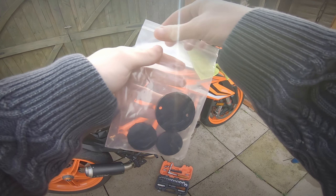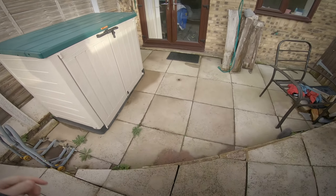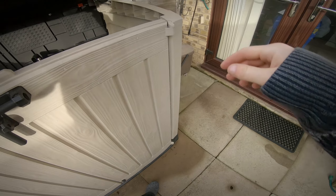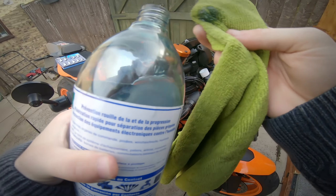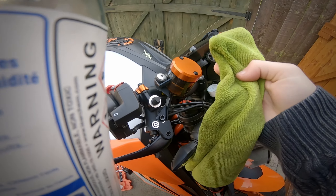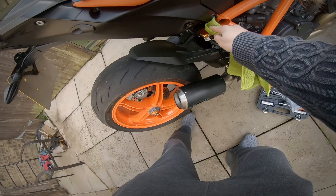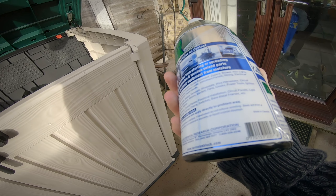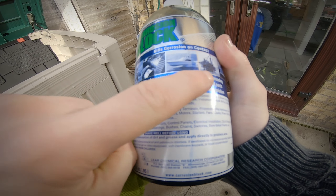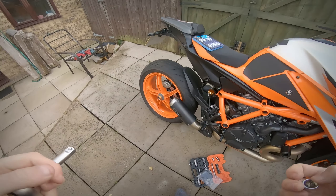Make sure they're cleaned out — I can feel the brake fluid on my fingers. I'm just going to get some ACF and just coat them a little bit. It's aluminium, it won't corrode as such, but just for cleaning it, just wax some ACF onto here. This is not really necessary but I just like doing it — it's a really nice cleaner as well. And on this one — anyone interested, this is Corrosion Block, the marine version for boats. I use this one over the normal stuff — a little bit of extra salt corrosion protection for our shitty winters here in the UK.